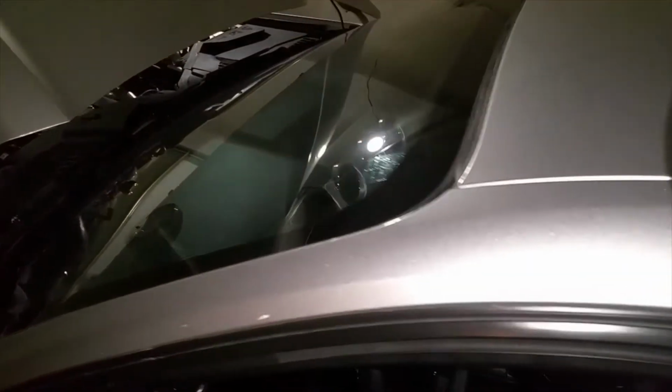Here is the second part right here, guys. If you have a Mustang, if you don't, it don't matter. That's all you gotta do is find where your fuel pump is at. You can either do it this way, or you can disconnect your fuel relay, which is underneath your engine bay. You can turn off the fuel pumps.